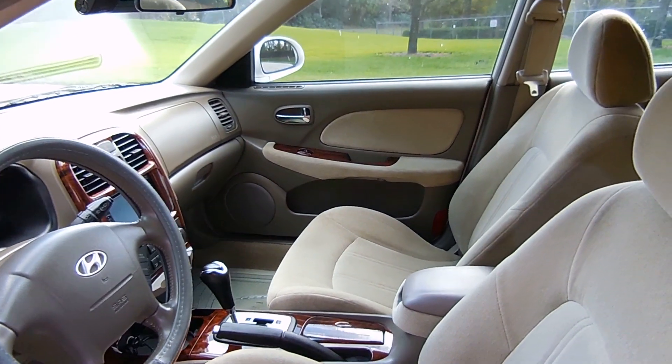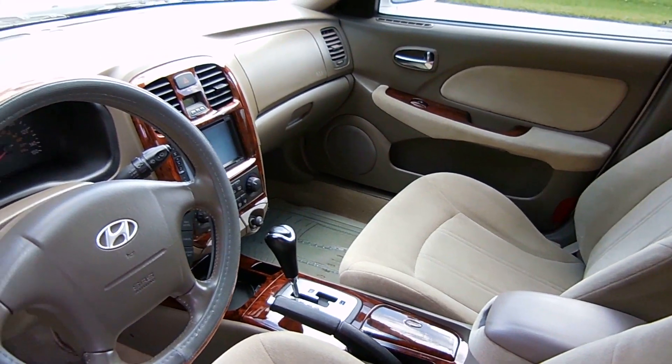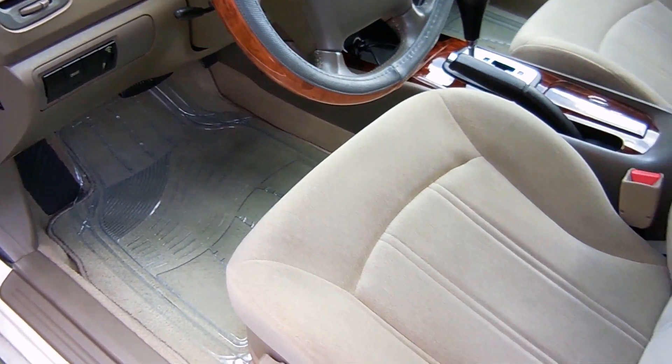As you just saw, the DC voltage measurement was low. Now I'm not surprised the alternator stopped working, because after all the car is close to 18 years old, has 142,000 miles, and the alternator is the original.